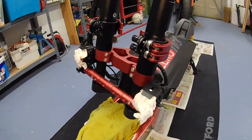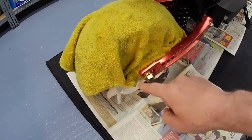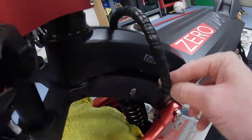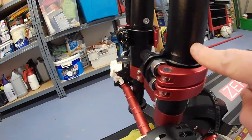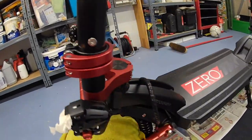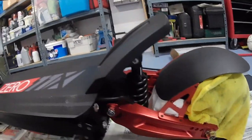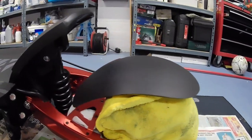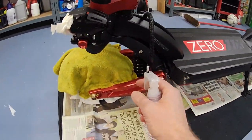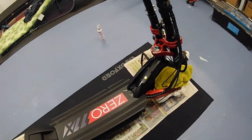So we've masked over all the areas we don't want it to go — the lights, tires, and discs. Where the hub motors are located is fine, suspension is fine, any exposed wiring is fine, bolt heads are okay, especially in these recessed areas — they're absolutely fine to be covered. Similarly along the main body, and also around the back covering the rear wheel and brake assembly. Now we'll just get the ACF 50 and spray it on.